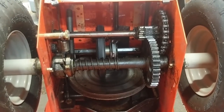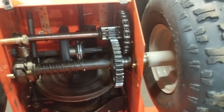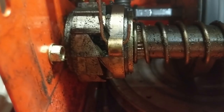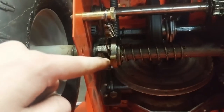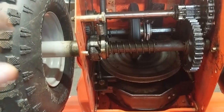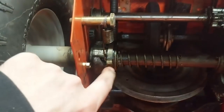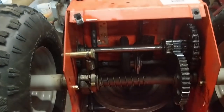Because I had the oil and gas drained from this machine I flipped it up, and I noticed that the freewheel engage over here is seized in the freewheel position. This tire just spins freely because that little dog that engages the axle is seized. So I'm going to try to pry it out, rotate the wheel to the point where it's at its deepest spot, go in there with some grease and try to pop that over, and then probably lubricate the cable that goes up.